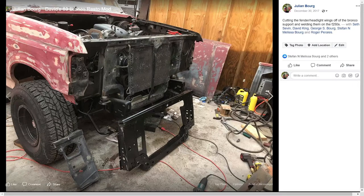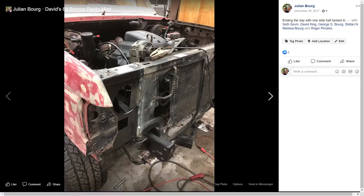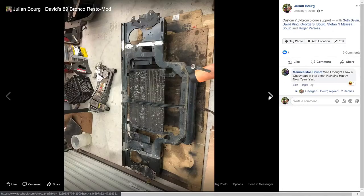So this happened: we bought a brand new core support for the Bronco because the original was all rusted out, and it hurt David's heart. I cut the wings off the side of the F-250's core support and then took the wings from the Bronco's core support and welded them onto the F-250's core support so it could hold the fenders. I had the fenders floated in place to make sure everything lined up. I did some light tack welding first so I could tweak it, then came back and heavily welded it, and finished it off with a flap disc to make it nice and smooth.